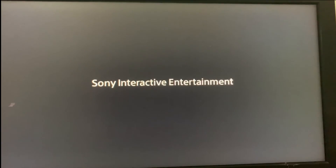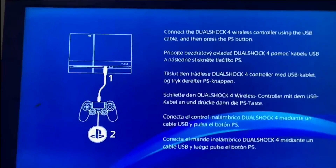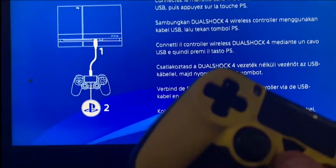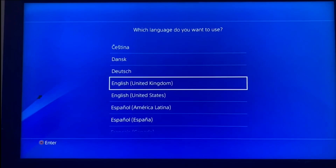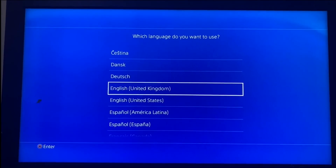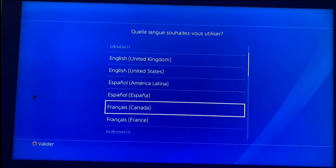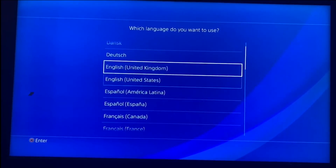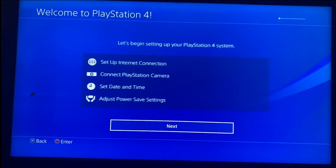Finally, you get to this page, which means your PlayStation has been recovered. After this, you have to set up your PlayStation. Because the file I put in the USB drive was the reinstallation file, my PS4 returned to factory settings. If you use the update file, it will be different — it will only update the system. Be careful of that distinction. Good luck fixing your PlayStation 4. If you learned anything, click the like button, subscribe to the channel, and leave a comment if you have any questions.